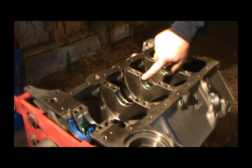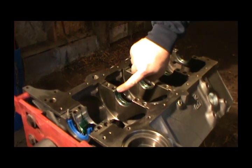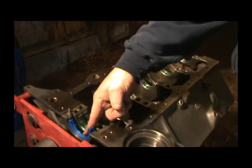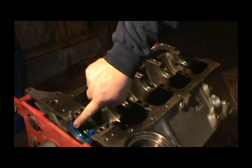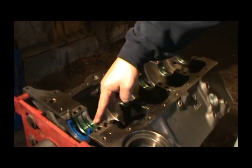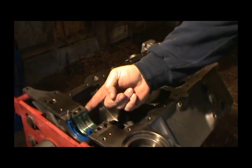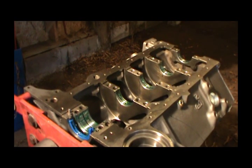We'll be turning this crank so it does need lubrication. Before we start it we'll prime up the oil pump and make sure everything is lubed like it's supposed to be. Also on this seal you want to get some of this oil on the seal good too — it will help keep that seal from rubbing your crank dry. And you want some on the thrust bearing part of this too. Now we're ready for the crank.